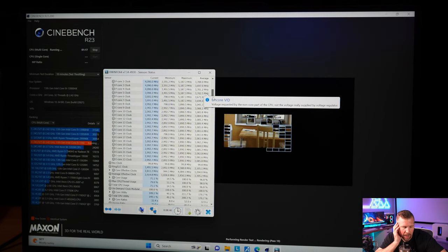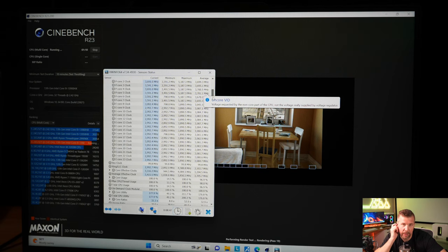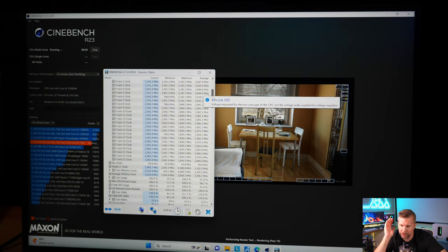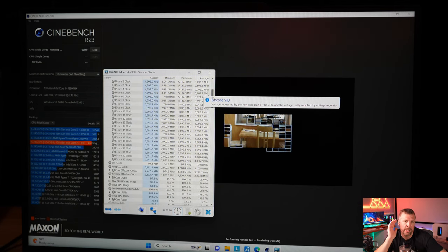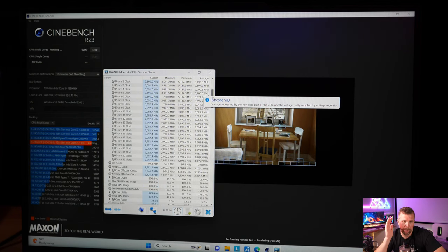But Steven Asher says, Zen 4 chips have aggressive boosting behavior that almost always hugs that TjMax. Yeah, if you set all the Ryzen chips to the max performance profile modes, like turbo mode on the Asus Duo 16 or manual mode with highest power limits, it just hugs that max throttle temp and tries to put out as much performance as possible. That makes sense because as far as we know, it seems to be very safe and stable, it's not causing crashes, 1% lows or stutters, and AMD believes it's not going to damage the system at all either.